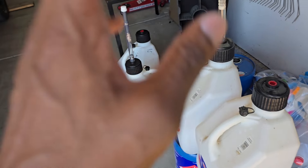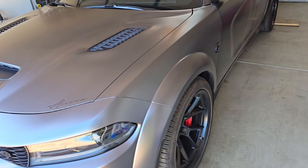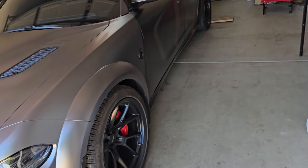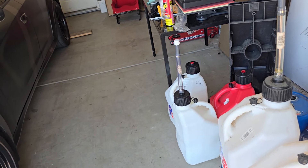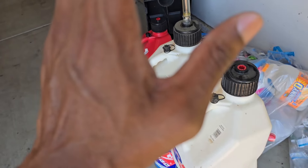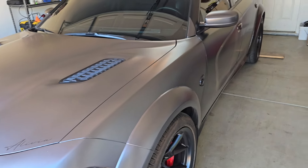I'm going to refill it back up because he did mention make sure it's above half. That was pretty much standard for my last Hellcat - make sure it's above halfway when you're going out here making pulls. You could drive it below that, but I wouldn't do it too often because those fuel pumps can burn up easily, especially those strong ones. I definitely wouldn't be making pulls anywhere below halfway. So I got some extra Ignite - I'm going to throw that in there and get it back above the halfway point.